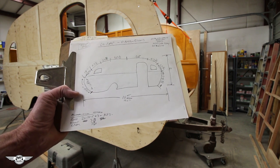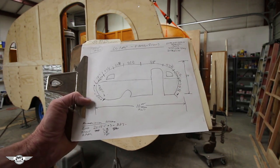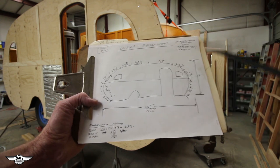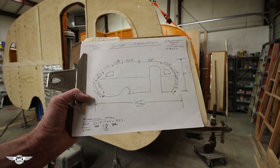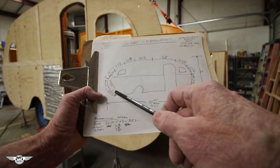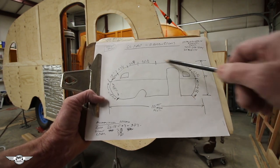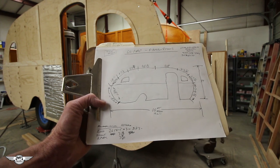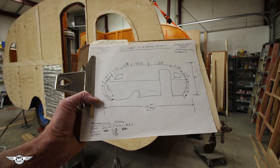My panels will be cut accordingly and set right on there. The only other full 48-inch sheet we have is this piece right here — you can call that the key sheet over the door. You only use the key sheet first when you're dealing with a piecemeal project. When you're dealing with a frame-off you have to get the floor level and get it jacked up so it doesn't move. You have to get your radius in the front and the rear started first. Any deviation we have to deal with will be handled on our last sheet that goes in the middle — what we normally call the key sheet.